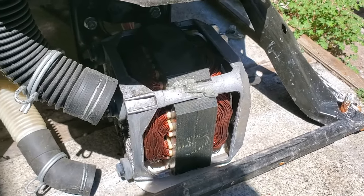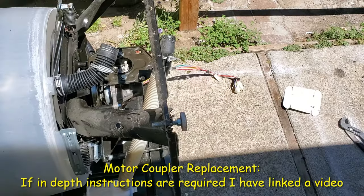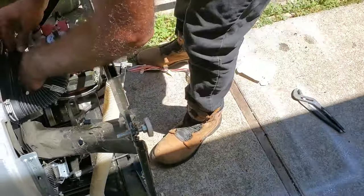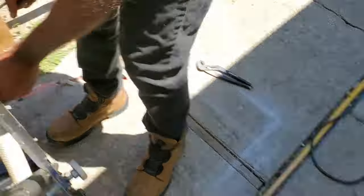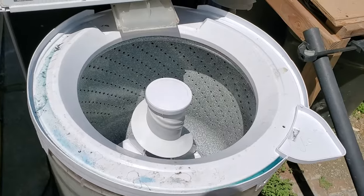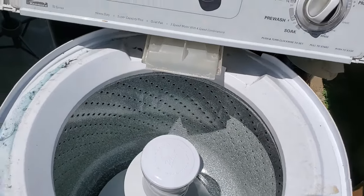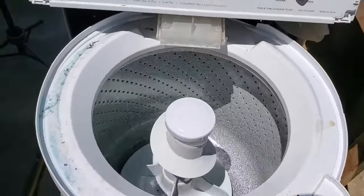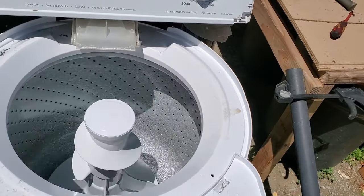That's nine reasons why your direct-drive washer is not spinning. I'm going to go ahead and replace that coupler, and this one should be ready to go. I've installed the new coupler and reinstalled the motor and drain pump. Let's see if that solves the issue — I'm pretty sure it will, because it helps to have the motor coupled to the transmission. We're going to put this on a spin and see — there you go, problem solved! If you like this video, make sure you subscribe to my channel for more DIY videos, and hopefully this helped you.